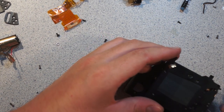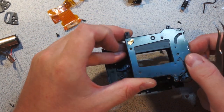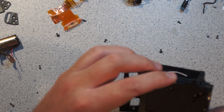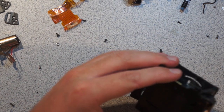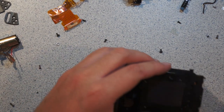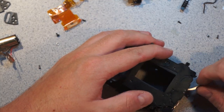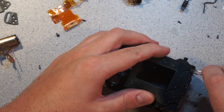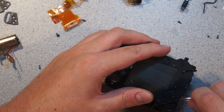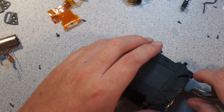Well, first of all, anyways, I can open the shutter. So there's a nice example of what it looks like when these things actually move. There is one of the curtains, and here's the other. Okay, I'm starting to see how this works. So, the real issue is, how is it caught? Oh, okay, I know what happens. These two are both spring-loaded. You can see how they pop back. So I would assume that they're both latched on. Basically, they're cocked upwards, and then these two electromagnets are energized, which hold them in place.